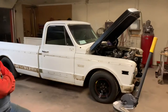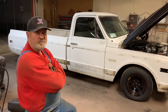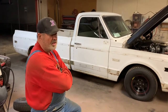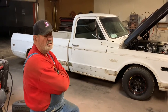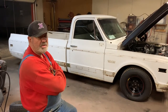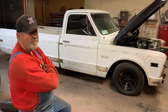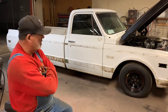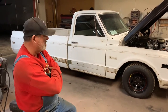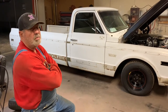So Bill, why don't you run us through this thing — just kind of what you did to it. Let's start with brakes and suspension and what you've done to it since you got it. When you got it, it was pretty much completely stock, right? Yes, it was bone stock. My neighbor's mom and dad bought it new down at a dealership in Kemswick, Missouri, and it's been in their family until I bought it two years ago. It also had a stake bed on it and six lug wheels. It has leaf springs, which is odd for this C-10. I took the six lug off and put five on five Chevy bolt pattern on it, with B-body Caprice front spindles which had the five on five pattern. Then I bought custom axles with five on five. It's got a 12-bolt rear end.